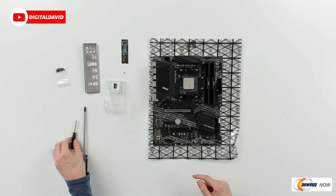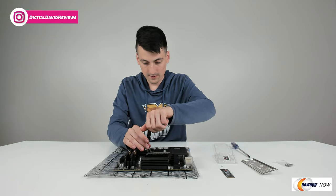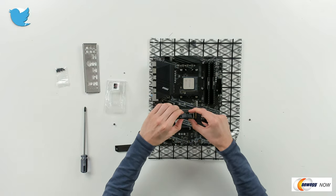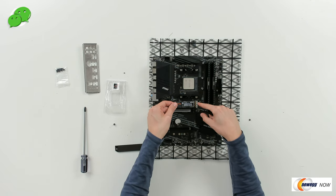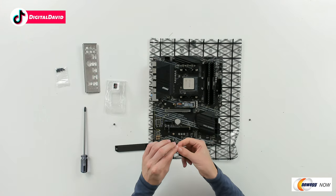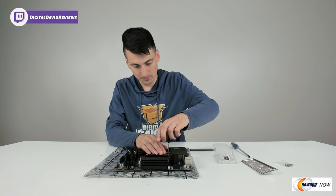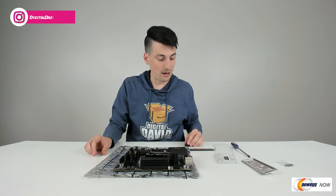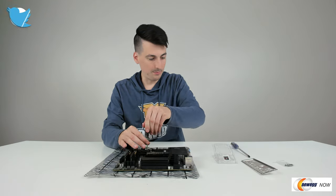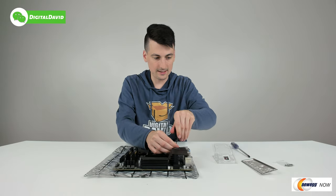Now we're ready to install the M.2 drive. So let's take our screwdriver and loosen it up. We got the first screw out, and these are going to be different size screws, so let's keep them separated. Same with the heat sink here. And now we can go ahead and install our drive. You may have a different size drive, so you can see we have a ton of different options. Then you just press it in, and we're going to take our M.2 screw. It's already in the correct spot and position for us, so we can just very gently tighten it in place. We have it installed. Now we can put the heat sink back on, line everything up, take our screw, gently tighten it back down. Just line everything up and screw it in place till it's nice and firm and snug.